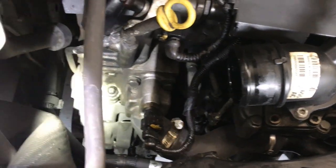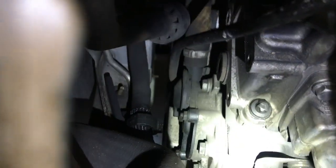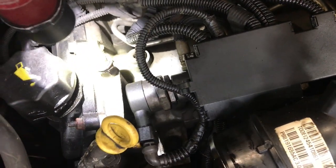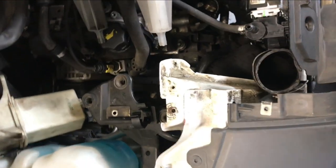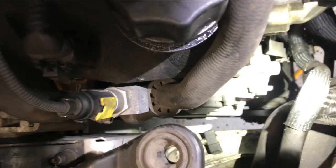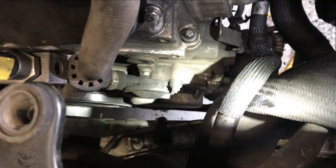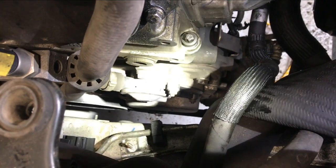We got the hose off from the intercooler. Now I need to remove the dipstick — the dipstick is right in front of that cover. That's the 10mm bolt, which is also the one that holds the top engine cover that always falls apart. I removed the headlight and the bottle again to have more room, because obviously the more room you have, the easier and faster it's going to be. Now I've got plenty of room to take those three nuts off and pry that crankcase cover off.